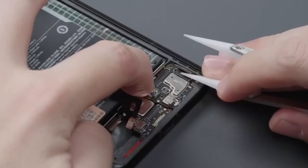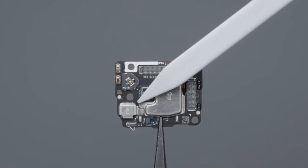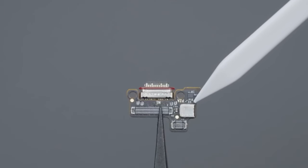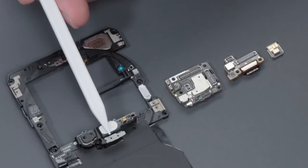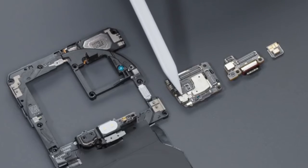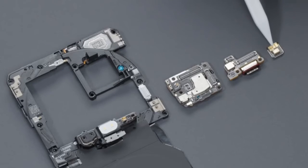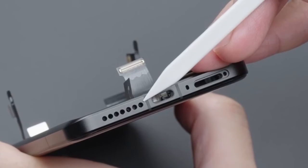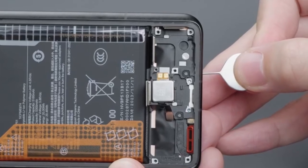A microphone and card slot are integrated on the auxiliary board. There is also a second bottom microphone and Type-C interface on the tail plug-in small board. The whole machine has four microphones in total — consistent with 14 Pro — capable of collecting sounds from up, down, left, right, front and back in six directions simultaneously. For video recording, this enables directional sound receiving effects such as the voice becoming larger with picture enlargement. The two bottom microphone receiving holes are designed on the left and right sides of the Type-C interface, with L-type anti-insertion designs to avoid damage caused by errors.